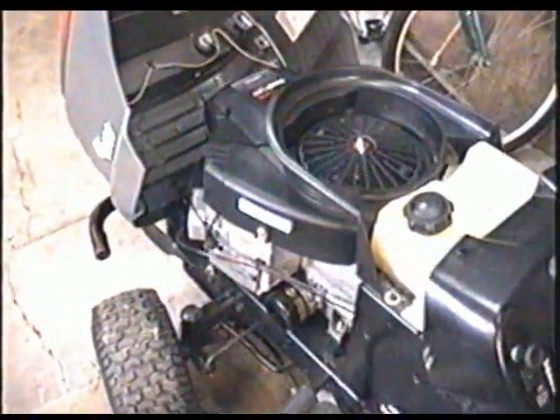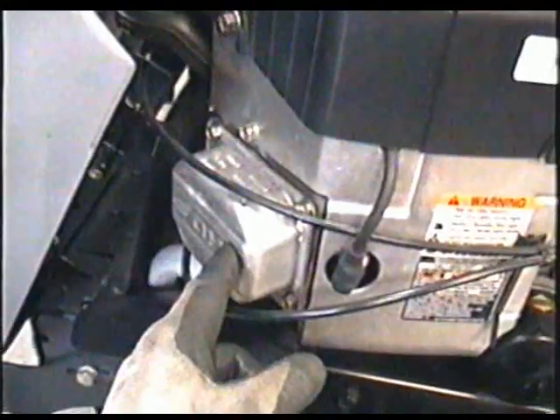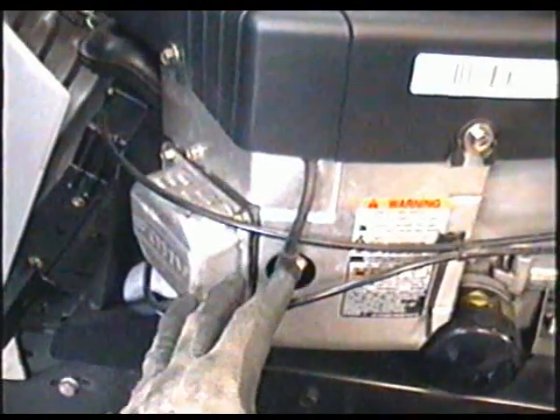Here's my personal tractor with a Briggs V-twin overhead valve engine — you can tell by the cover. What happens sometimes is the valves get loose and you have to take these covers off and readjust the valves, because when valves aren't opening when they should they create a lot of compression inside the engine, making it hard to turn over even with a brand new battery. I have a video on my channel called 'How to Repair Hard to Start Lawn Tractor Engine' where I adjust the valves on a single cylinder Briggs and Stratton overhead valve engine and I was having the same problem.